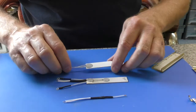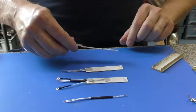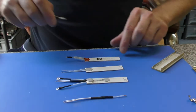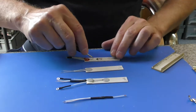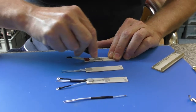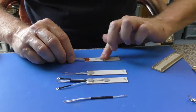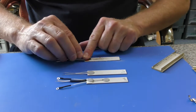So if you've got the old element that you have the faulty thermistor on, you'll find it's got this sort of black brittle glue that was applied to it originally. The thermistor has probably broken away as you took this apart, and what you can do is simply use a sharp edged implement like this little flat jeweler screwdriver. You can scrape off the old glue. You would then place this in place.